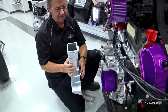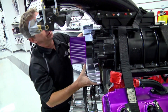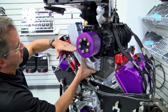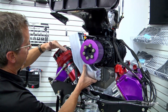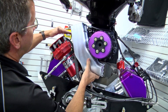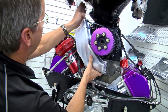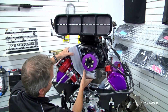What we've basically done is make a little chimney to get that pressure out of there. This piece comes up here and these are made long so they can be cut off — your hood line will vary depending on the body style. Sometimes the hood line is down here with a cutout around the supercharger and mag, sometimes it goes over the top of the mag. These are made to be trimmed at your hood line, and we actually like to trim them at a slight angle so the force goes out and stays away from the carbon hat.